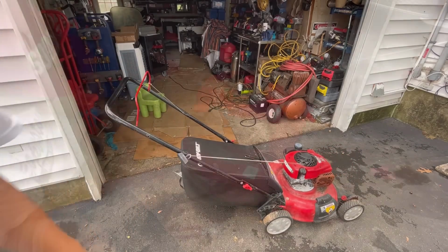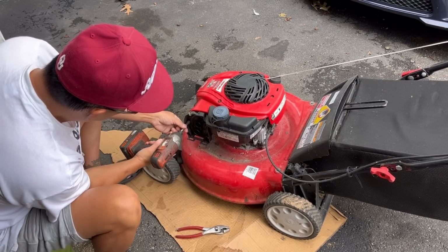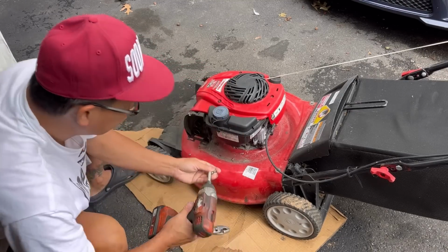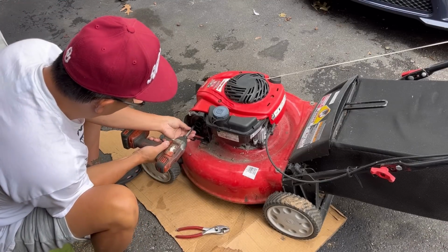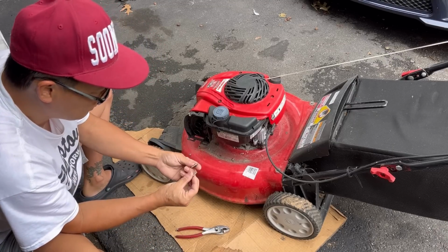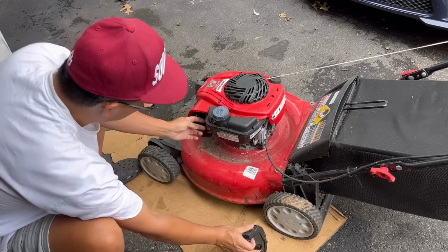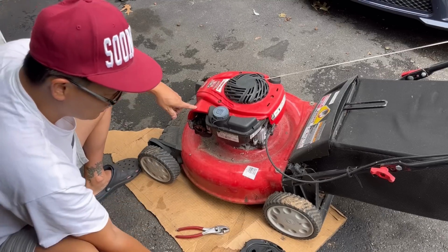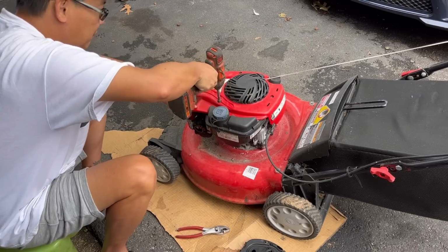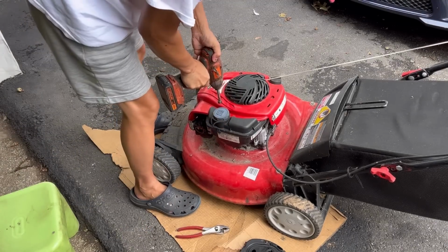Nope. Let's take the carburetor apart. Got some 5/16. Center ones are smaller, some ridiculous size, like 9/32 or something, that hold the carburetor onto the air filter base. And these screws look like that. Long threaded. Base comes out, disconnect the vent tube here. It's probably easier if we took this out so we can see what's going on. Change it to a 5/16. There's just 2 of them, 3 of them. They're very rusted. Very rusted. This thing's been outside a lot.